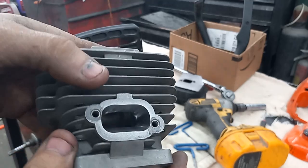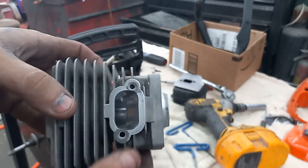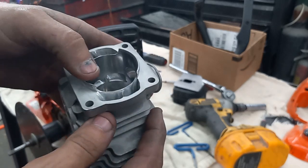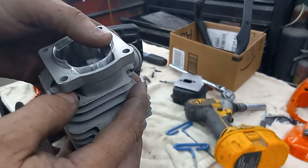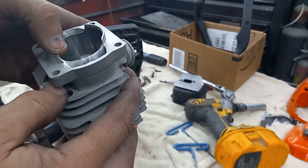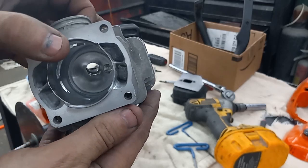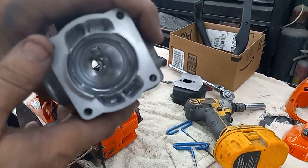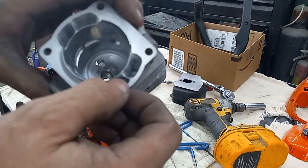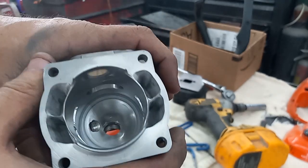I don't have my flashlight, it's charging right now. But there's the exhaust. Like I said, I cut this out huge. When you do it as big as I do, a second ring plays heck getting in there — it's a little fidgety, but if you're careful you can do it. I opened up the transfers absolutely massive. I took them as far as I dared. I could probably go a little more out on the wall, but for 50 cc's these are plenty big enough.